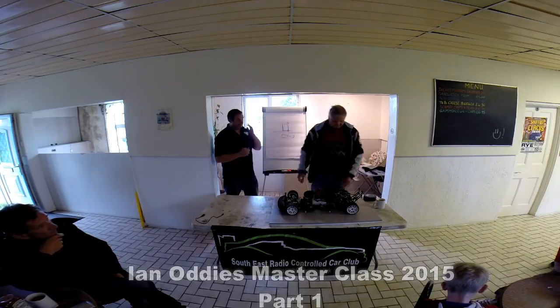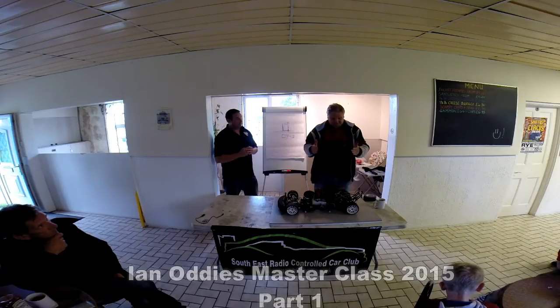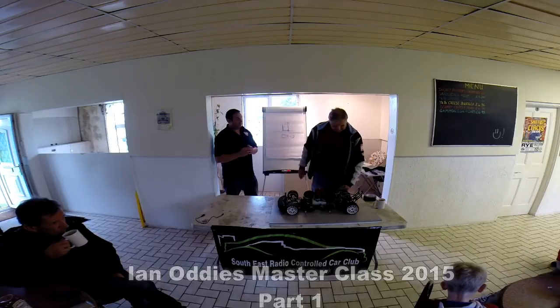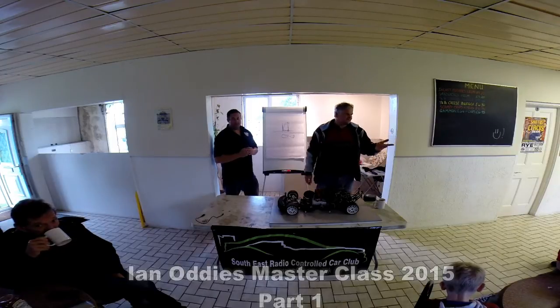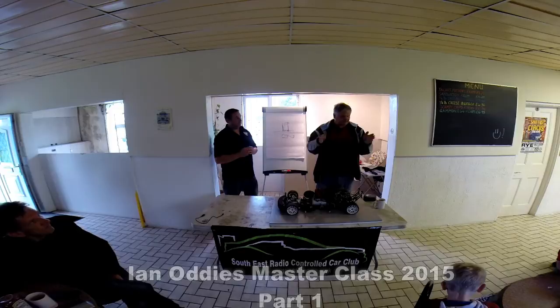On the back, unless you've got bump steer, which most cars can't have bar an RS5, and on the RS5 you can deliberately put bump steer on it for some performance benefits. I'll get to that later. It shouldn't change with suspension movement because it's fixed on the bottom arm. I'm thinking of Formula 1 with all the little links. Well, that's the same as the RS5 on the touring cars. You've got a link at the back and you can adjust the height of that to get the bump steer, and you can use that to steer the car as you're going into corners or generate more grip.